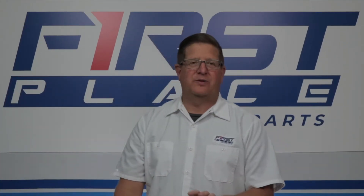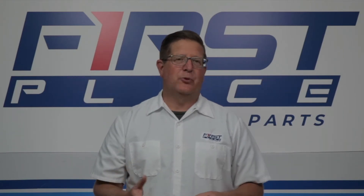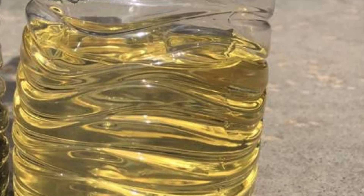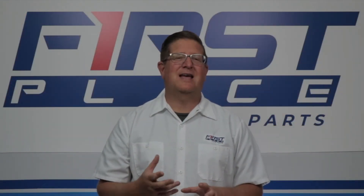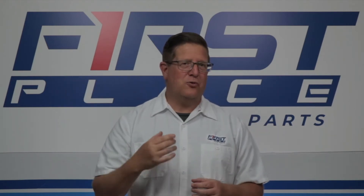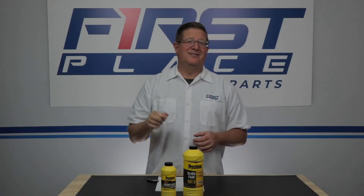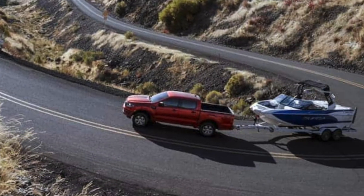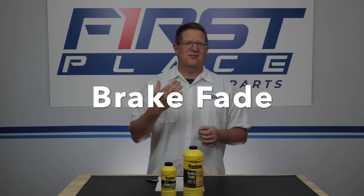Perhaps the most important factor with brake fluid is its boiling point. Boiling point with brake fluid is stated as both wet and dry. A dry boiling point is fresh brake fluid — right out of the container, not contaminated at all. The wet boiling point is once the fluid has been in the master cylinder for a while and has absorbed water. Brake fluid is considered compromised when it has 3.7% water content, at which point it needs to be flushed. The worst part is this happens when you're working your brakes the hardest — when you need them the most, the water vaporizes and makes your braking worse. This is also where we get the term brake fade.